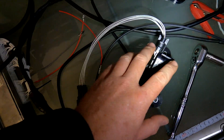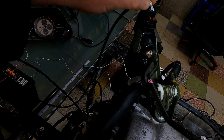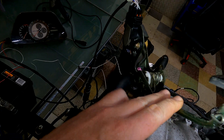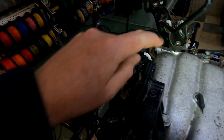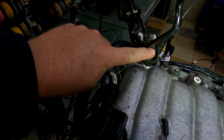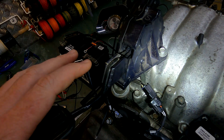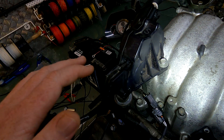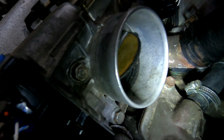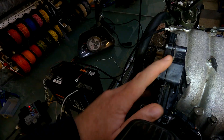If you've got your 2001 SC-430, GS-430, or LS-430 and you've done the swap with the original pedal and you're finding that it goes out of range, there are two solutions. Number one: put a stop and keep adjusting it as best you can to get it to work. Number two: get a newer-style enclosed throttle pedal, and that problem then goes away — the throttle no longer shuts down and everything works exactly as it's supposed to.